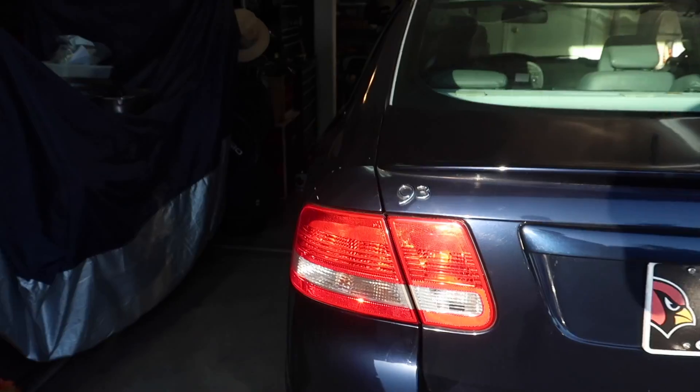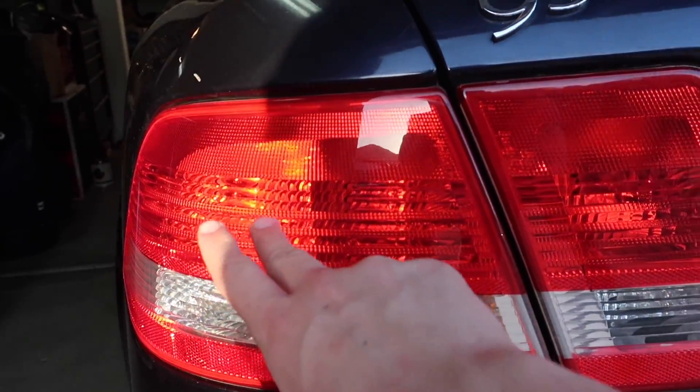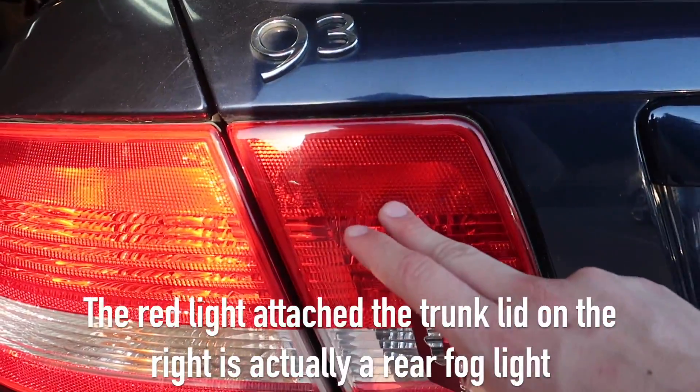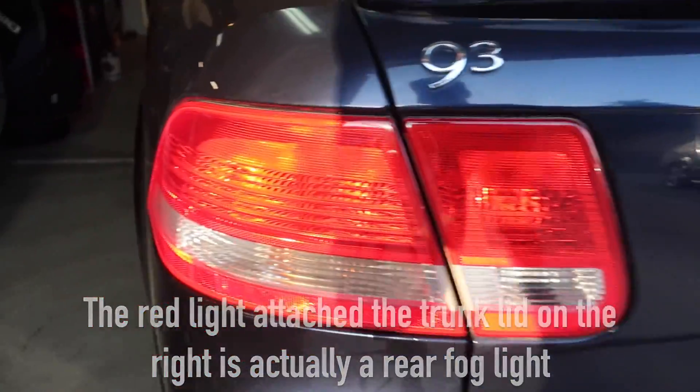What's going on everyone? Today we're going to be changing out one of the brake light bulbs on my 2003 Saab 9-3 ARC. I've been getting a message that says left brake light failure and sure enough one of the bulbs is out. If you look at your tail light — this is the same for a facelifted 9-3 too — you have two brake light bulbs here and here, a third one here, then your turn signal and your reverse. Same goes for the other side.